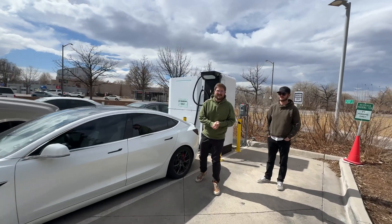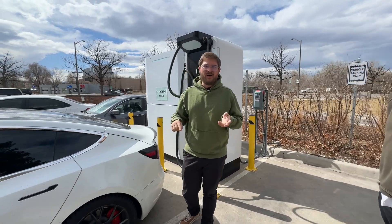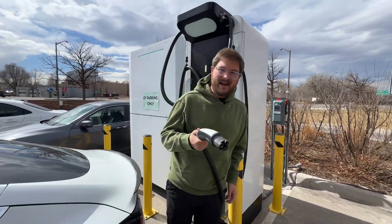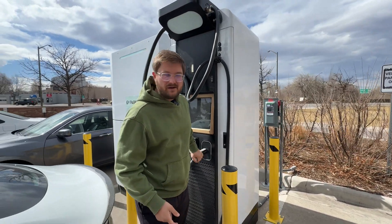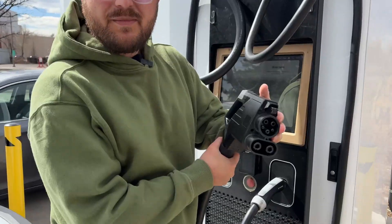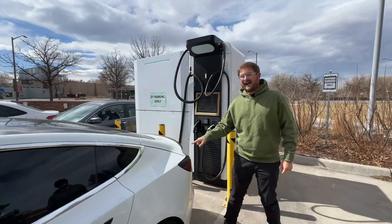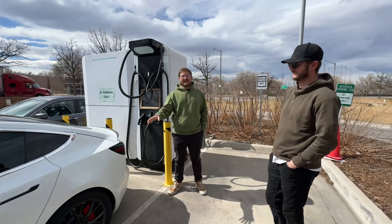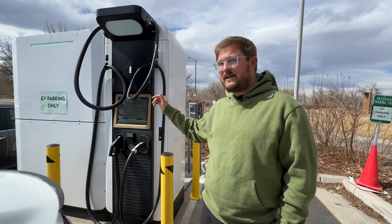Hello and welcome to another Out of Spec Bits episode. This is more of a PSA, especially for those of you who drive or own older Tesla vehicles where public charging stations are being equipped with NACS handles — J3400. We're here at our office. This is our DC fast charger, equipped with a J3400 or NACS style connector, which is different than CCS in shape but not in terms of communication. In order to charge an older Tesla at a NACS station, you need to do a CCS retrofit. We're going to break that down and explain everything you need to know about charging an older Tesla on public DC fast charging stations.